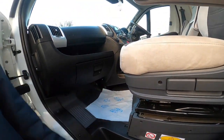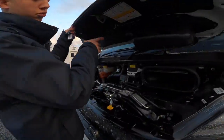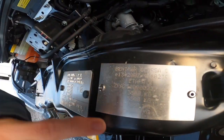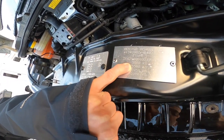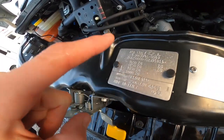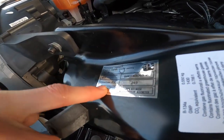Should you need to access underneath the bonnet, the release is on the side of the dashboard. Under the bonnet, first you've got your chassis number in the windscreen and on your weight plate — go off the Benamar plate. This is 3.5 tonnes; you can tow 2 tonnes behind, so the motorhome and trailer combined train weight can't exceed 5,500 kg (5.5 tonnes). The chassis cab plate you can ignore as the weight there differs. You've also got your paint code should you need any white paint.